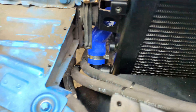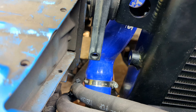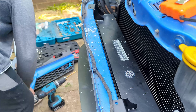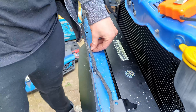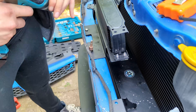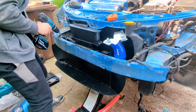With the cooler attached by M6 bolts and rivnuts it's so much cleaner, and the bolts won't have to be replaced every single time the cooler comes off in the future, which they probably would have with those self-tappers. Here I'm doing the exact same for the intercooler brackets - having already marked the locations, the holes are drilled with a centre punch before moving the intercooler out of the way so I can get a drill in. Airtek expect you to mount it with self-tapping screws, which just doesn't fill me with confidence. I also noted that the only rivnuts I have are galvanised steel, which is more electronegative than the aluminium crash bar so it could cause some corrosion, but I'll keep an eye on it - you can get aluminium rivnuts to replace them in the future.